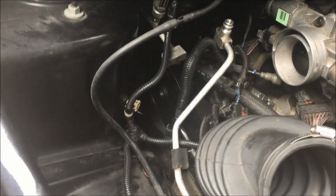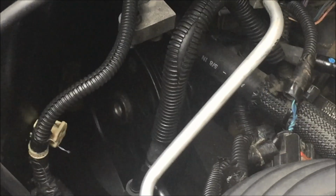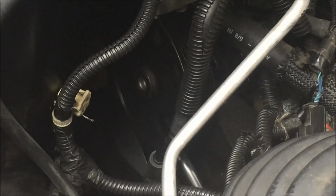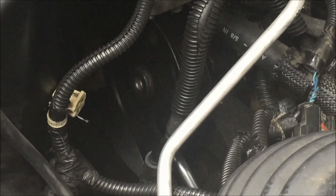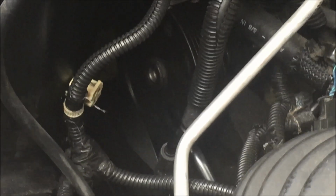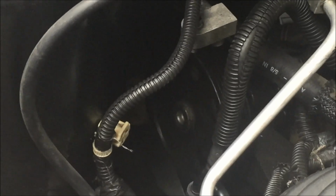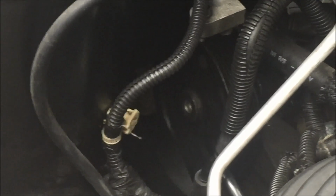Another tip: when you put the pump back in and you bolt it down, don't tighten down any of the bolts too hard. Get it in, and then rotate the socket around between the 3 bolts, and get them in there, more or less even. Okay. And the same tip I said before, I would use a loose socket in your hand just to twist those bolts on, because they go in pretty deep.